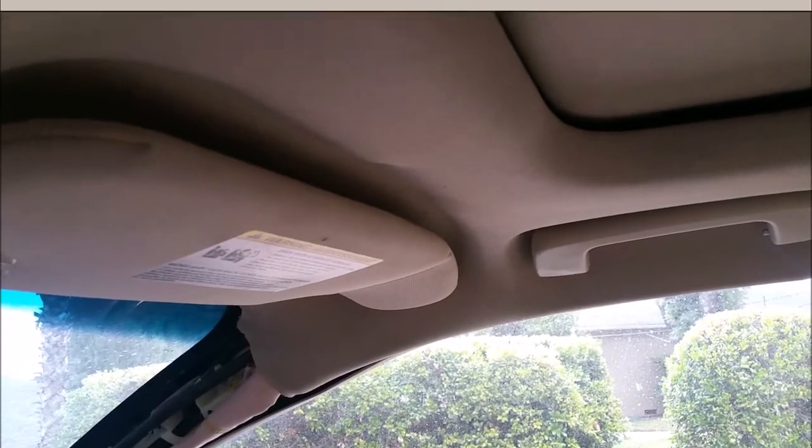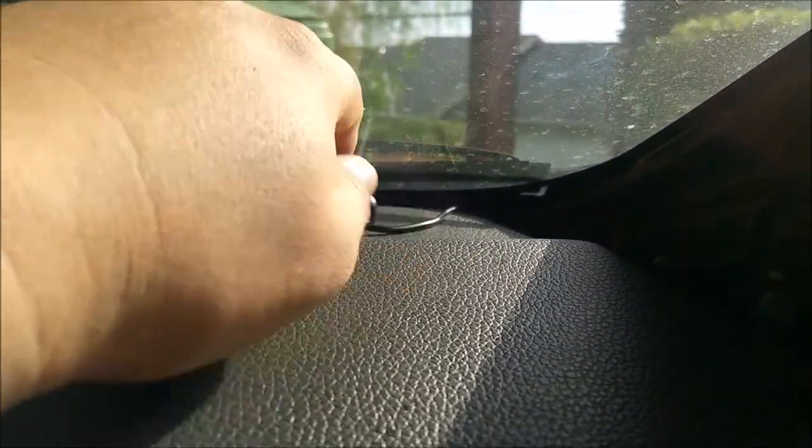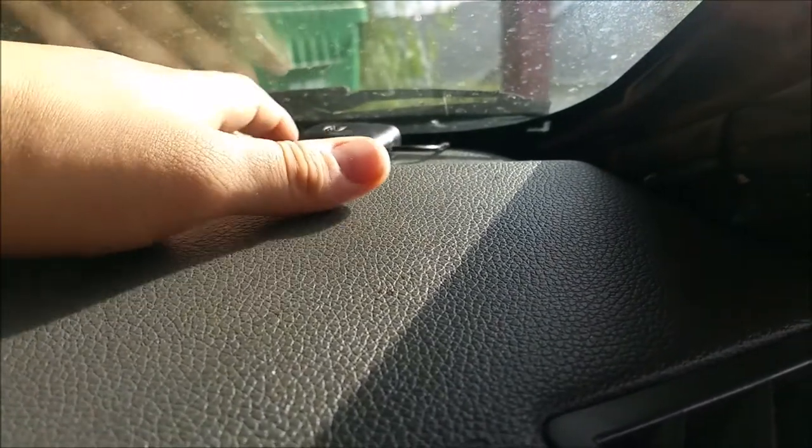Each car will be a little different but most of the time it's just a pull-out. Be careful because you'll have your airbag back there. I'm going to run the GPS up through here — you can slide your fingers underneath. I'll also run the cable straight back through the headliner. I ran the wire and tucked it behind here, mostly just to pin it in place. The important thing to remember: if you do have airbags, try not to run your wires in front of them.